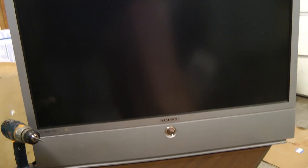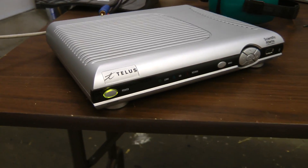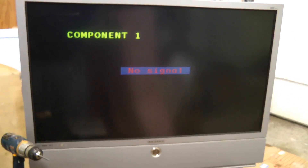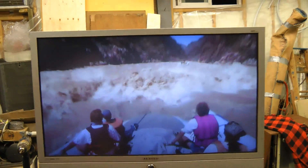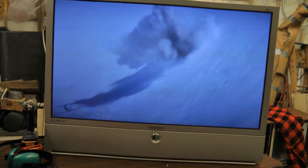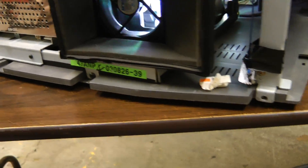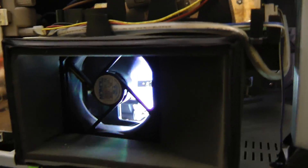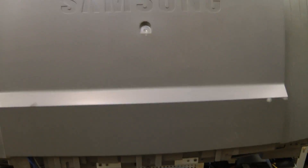Let's see if this will give us some TV. This box is working now, and the image on this TV actually doesn't look very good. Maybe I'm just used to phosphor-based displays like CRTs and plasmas, but this just looks quite horrible — I would never want to watch this. The problem could also have to do with smoke. It has that smell like it was in a smoker's house, and it's possible the smoke has gotten inside the housing and gotten on the lens or on the screen, causing the light to diffuse. That could be partially why it looks so bad.